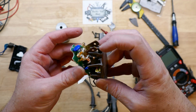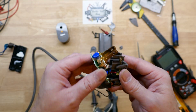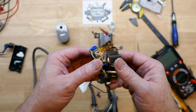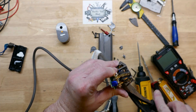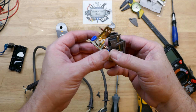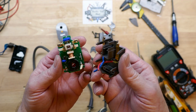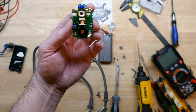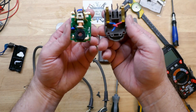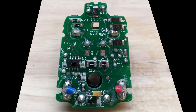Here's a different view of the contact points, which are very heavy duty, coming off the blades of your plug. Pretty neat how they got this into such a small package. We'll cut these wires off and I'll be able to give you some photos of the board as well. There's a look at our toroid for current sensing, and a better look at the coil and the contacts. It works very similarly to most GFCIs but in a pretty small package. Here's a close-up of the board, and I hope you enjoyed this video looking inside the mystery box and GFCI of this Dyson hairdryer.